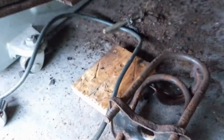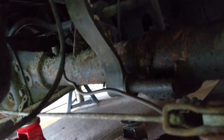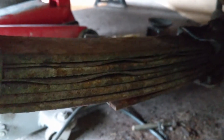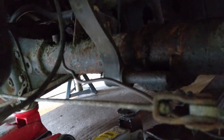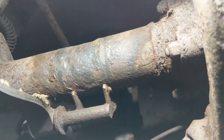The u-bolts go over the top and down through. This plate here goes in the middle, and then underneath we've got this plate which is attached to the shock absorber hidden up in there. We've still got these bits rusted on so we're going to have to take a wire wheel to that and clean it all off. Having done that we'll look at installing the new one — we'll wire wheel everything first, clean it off, and see if we actually want to paint them all as well.